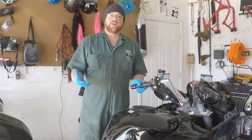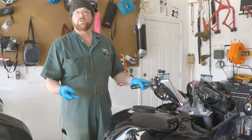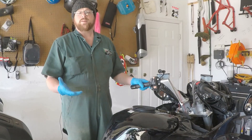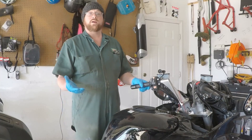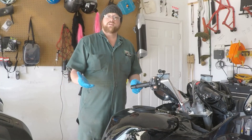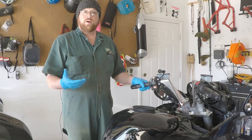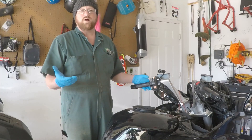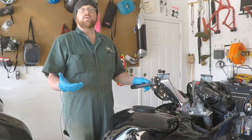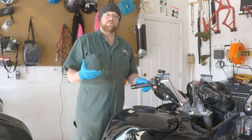So what is switched power? If you're looking at putting electrical accessories on your bike like a cell phone charger, a chain oiler, GPS, something like that, you've probably heard somebody tell you that you ought to put it on switched power. What does that mean? Quite simply, it means that the device or the power source for the device only comes on when the bike's ignition is on. We want this obviously and simply because otherwise you run the risk of discharging your battery. So that's what it is and why we want it.